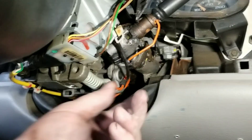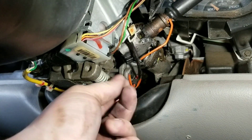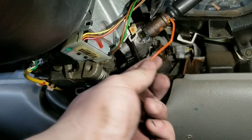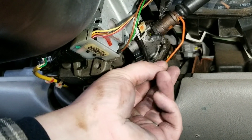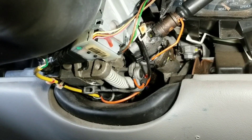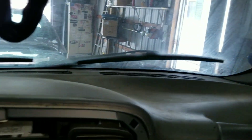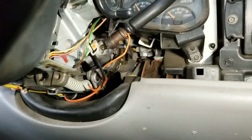So now, just like that, you can see right here — this is just where it popped off. So what I'll do is like I said, I add about an inch or so of wire. A lot of people try to squeeze that last little bit out of there, but what you don't realize is you're actually shortening it. So we're gonna lengthen it and give it a little bit more travel. Pretty much that's it. We'll test it after that. The vehicle is disgusting on the inside so I'm gonna clean some stuff up while I'm at it, and then catch up with you guys once the fix is done.